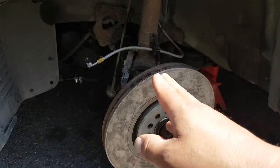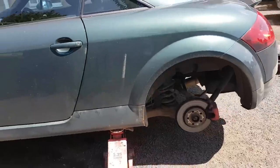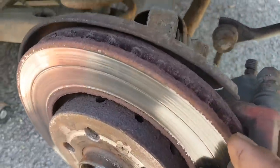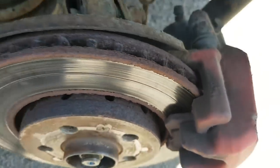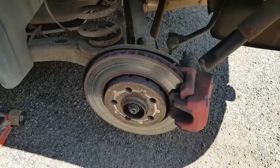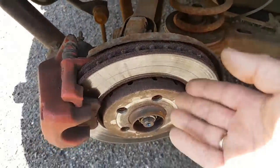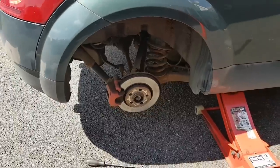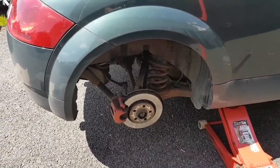We're going to work on the rear. The rear brakes were really bad - one side has been overheating. This side is binding really, really bad. The pads are nearly gone, probably because it's binding all the time. You feel the car braking as you drive it. The other side was not binding - you can see the difference in the disc. But we have all brand new stuff to put here. These calipers are going to have to be completely dismantled and refurbished.